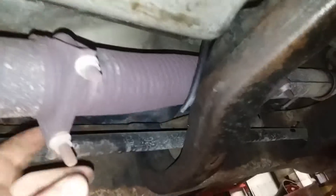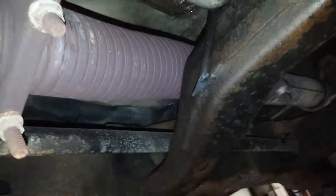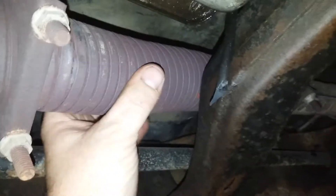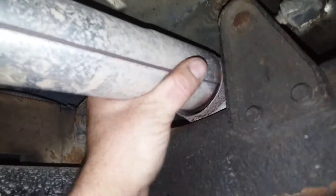Secondly, you'll notice there's no catalytic converter right here. There's a piece of flex pipe here banging on the crossmember, connected to a loose piece of exhaust pipe just stuck in this muffler pipe right here — not welded, not clamped, no attempt to secure it. The thing's louder than hell and sounds like absolute garbage.